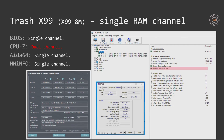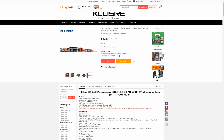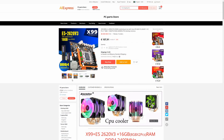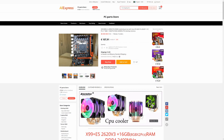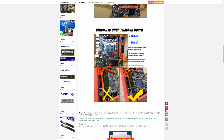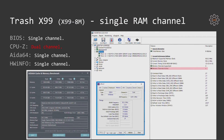If you don't have the motherboard yet, you can ask AliExpress sellers to show an AIDA64 screenshot. You can also read the description carefully — if a motherboard has 4 memory slots but the description says to install sticks into the orange slots first, that indicates just 2 memory channels. The orange slots are primary and the black ones are secondary on the same channels. The same applies to this motherboard: it has 2 slots but the description implies one is secondary, confirming it has just 1 memory channel.